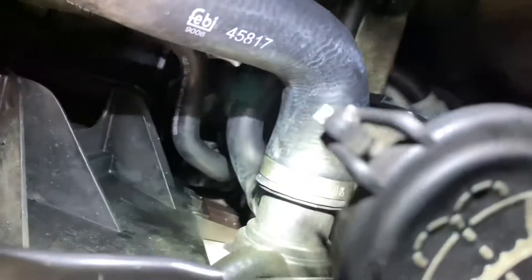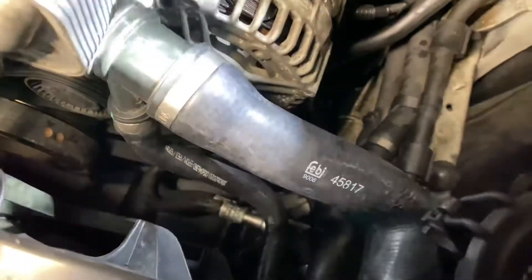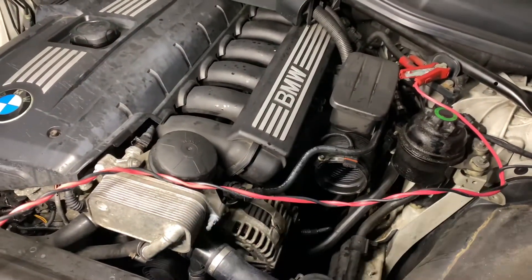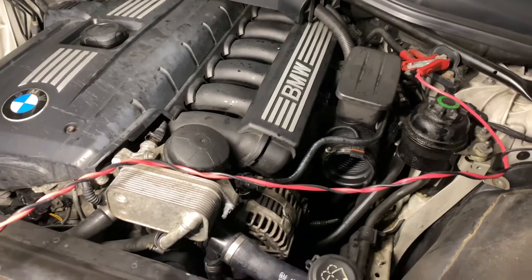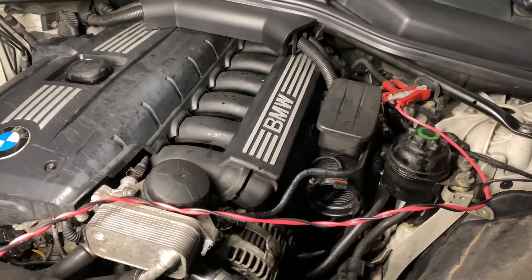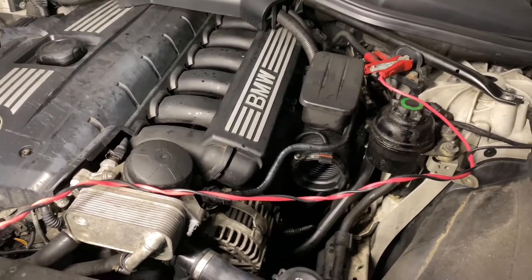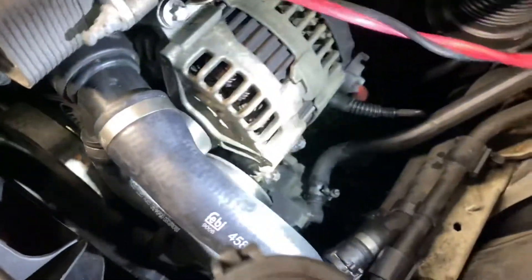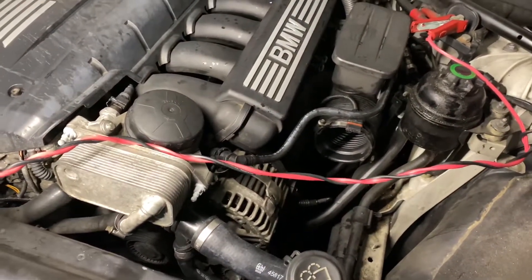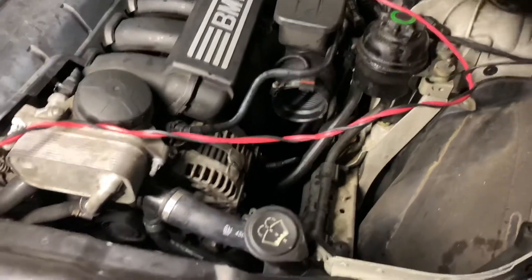What occurred with mine was the little clamp blew right off — just happened with use and age. It's kind of notorious with these 5 Series that the plastics degrade over time, because the fluids BMW uses have what I believe is called a plasticizer — it degrades the plastic and causes it to soften over time. It just broke loose of its sealed fitting. To fix it is actually pretty simple — it does not take a mechanic at all, just basic hand tools and some picks. All in all it takes about an hour.